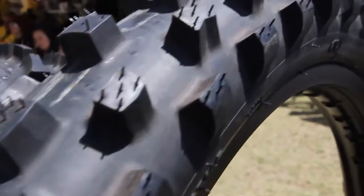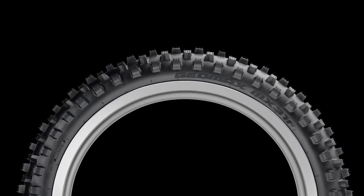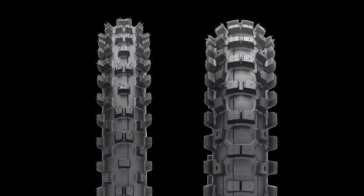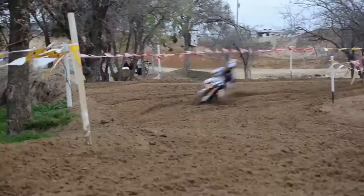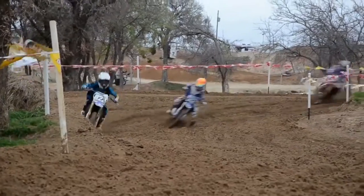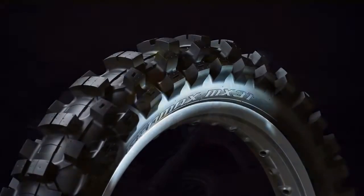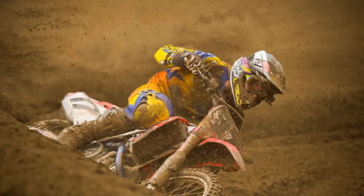When conditions get softer, you'll see some pro riders go with the soft terrain MX-31 front and an MX-51 rear, or an MX-31 front and rear combination. Sometimes it's just rider preference. That all MX-31 setup is a good combination for Midwest tracks where you have deep loam conditions. The MX-31 is popular for more grip in the front when riding in really soft conditions, such as a sandy track like Southwick.